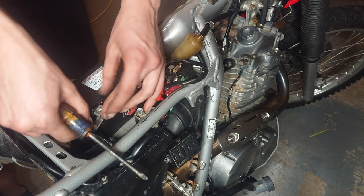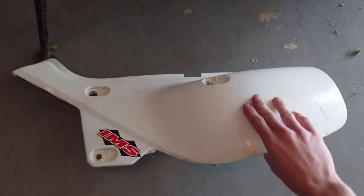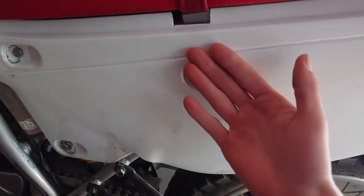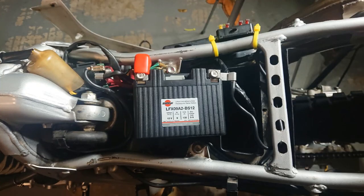It worked great. A few more details: on the seat there are two holes — you may have to dremel those down as well. You'll see another cut section on the side — do not cut yours, that's not necessary. Remove the extension arm because it's no longer needed and it's going to be flat. Here are just a few quick pictures of the whole setup, how I have it totally finalized, so you can have an idea of how I laid out my wiring. And of course the CDI on the inside showing how I mounted it.